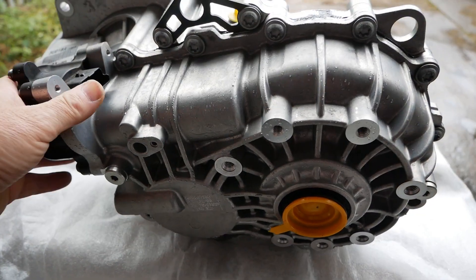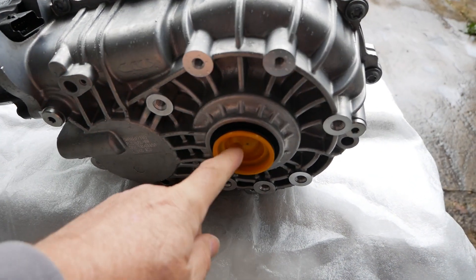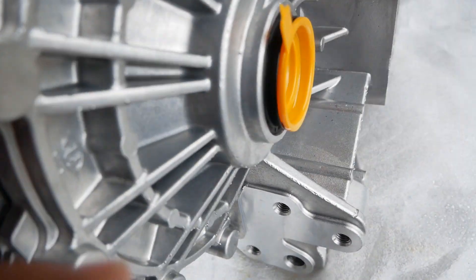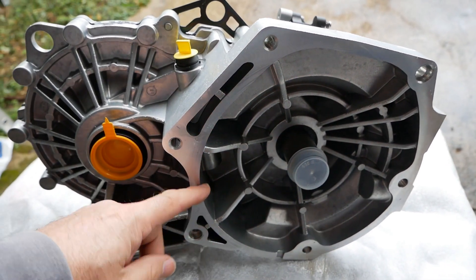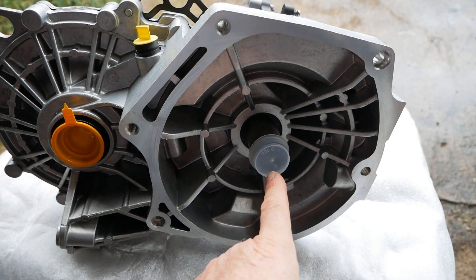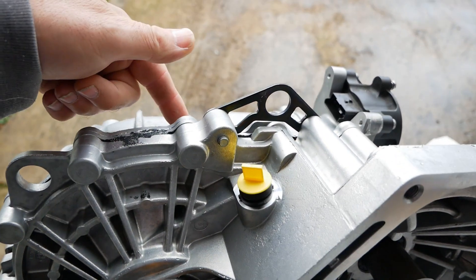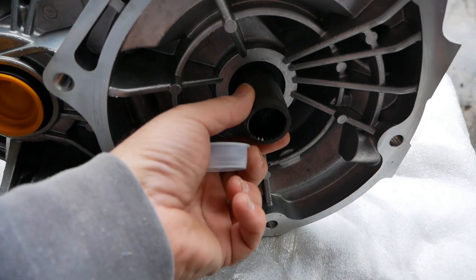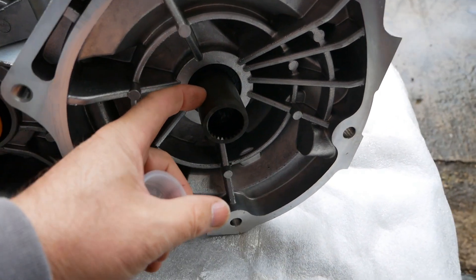A normal Castrol manual gearbox oil will be the thing to use. When this is sat in the vehicle it will be sat something like this, and this is where your driveshaft will be coming out to one of the wheels, with the other driveshaft coming out here. This area is bolted to the side of the electric motor — you've got your electric motor shaft coming in here, joined to this shaft which then turns all the gears in the reduction gearbox to drive your driveshafts.